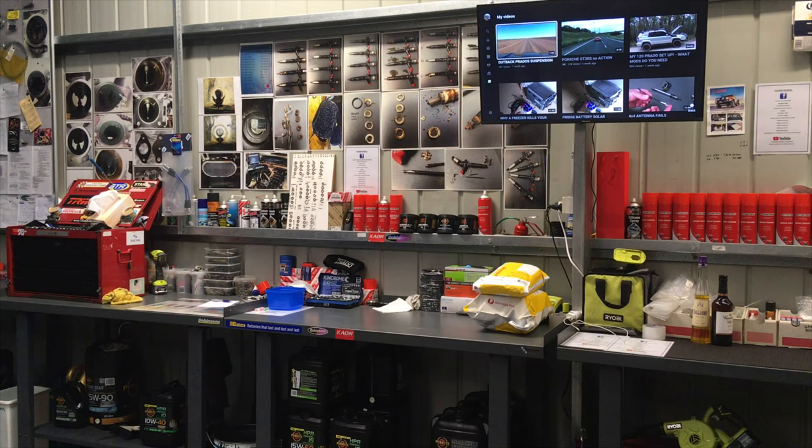Anyway, it doesn't matter. I've said it before, the product we use, and I'm not saying it's the best, it's just what we used. It's called Knockout. It's a Lubrimax trade product. They want you to put it in customers' cars when you service them, so when they get their car back, it's all nice and quiet and they're happy. Gee, Anthony, you're awesome, what did you do? That magic wand again. Nah, look, it increases the cetane, so it's going to help with the problem, but it's not really a problem. It's just increasing the cetane. So any diesel engine that's a bit noisy, a bit knocky, it's going to quieten it down. We use it in the 120. I think it does work a little bit.